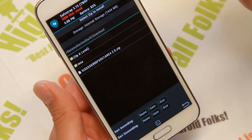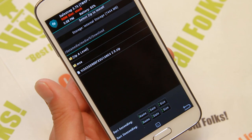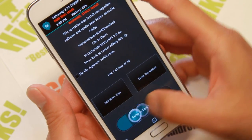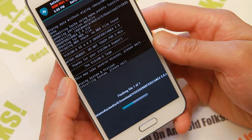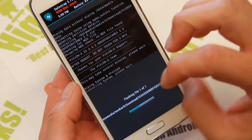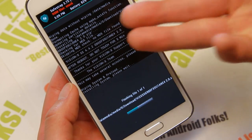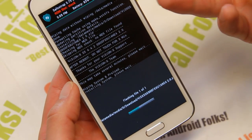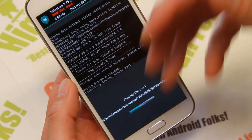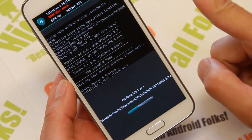Next, go to Install and choose the ROM you want to install. I'm going to install Vision X-ROM. For AT&T Galaxy S5, you can actually install all of the G900F International ROMs and also any T-Mobile ROMs. I'm going to go ahead and install this Vision ROM and confirm flash. This is installing. Some ROMs do have a graphical installer where you can choose various different options — perhaps some apps you don't want to install, you can customize all of that. But this one doesn't, so I'm going to simply install it and reboot, and you should be on the new ROM. Anytime you want to go back, or if you end up in a boot loop, you can always restore the stock ROM you backed up — so always have one good backup copy.